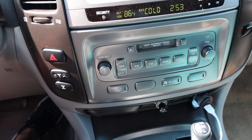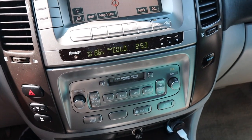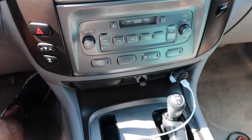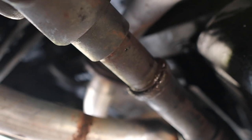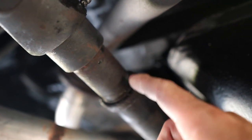At low speeds I don't hear any clunk on takeoff, and now we're getting to speed — nothing! Awesome. Now I want to get back under the car and check those slip yokes. Sure enough, grease has come out of the rear one — not a whole lot, but it has been pushed out from hitting the bumps. At the front I'm not seeing much grease pushed out, so maybe I could put a little more in there, or I'll just leave it for now and see how it does.